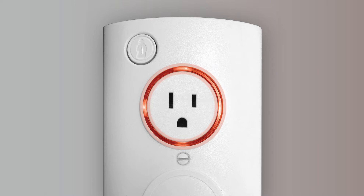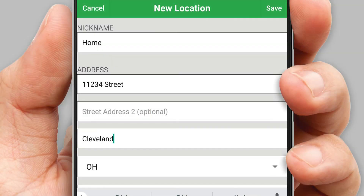If the LED ring on your smart outlet stays red, that means the Wi-Fi connection failed. Start the process over again and make sure that your password is spelled correctly. Continue the setup process on the app by entering the location of where the smart outlet is located.